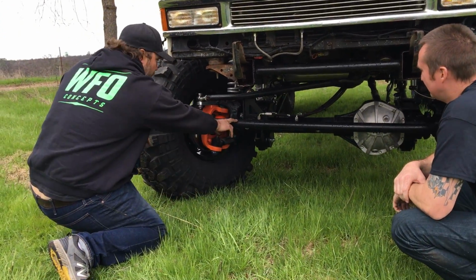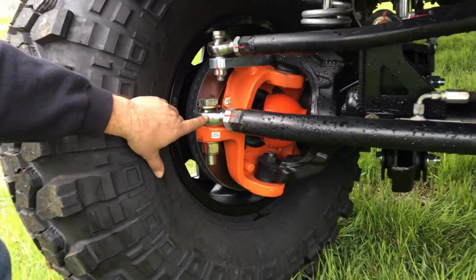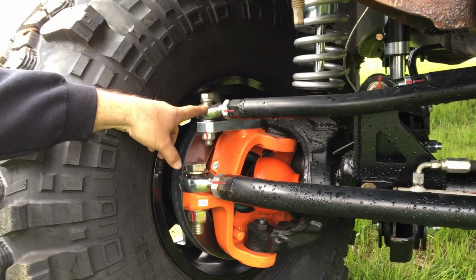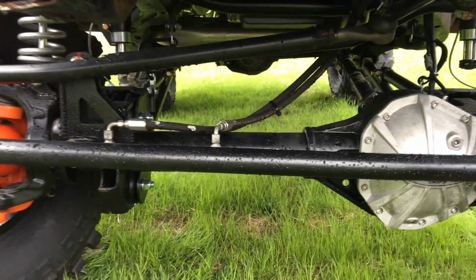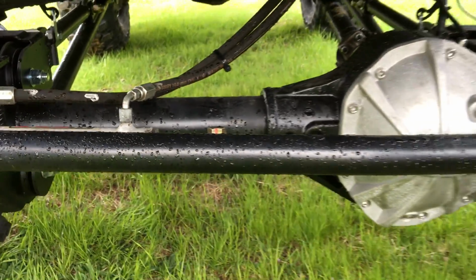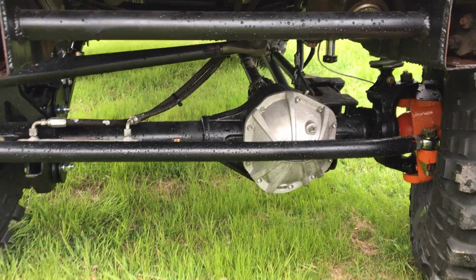This is 2-inch quarter wall, heavy-duty tie rod, PSC hydro assist. Actually has 1.25 inch heims on the tie rod with 1-inch bolts, 7/8 heims on the drag link. This is our crossover steering arm. So this is a kit we're kind of proofing out for the OBS trucks. And you made that cross member. Built our, it's got the first 3-piece cross member in there. We'll kind of walk around and see that.